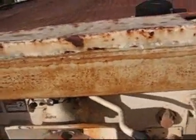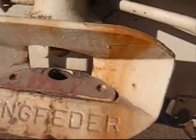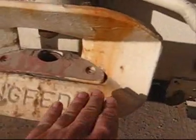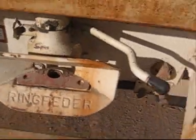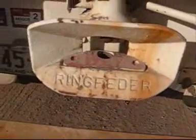Simple as that. All you've got to do is make sure that the drawbar is at the right height or a little bit low, and that's why they have this beveled edge as well. It doesn't matter if you're not directly straight on, it'll hit there and slide across and lock in, or if it's too low, it'll slide up and lock in. And it's very easy to do on your own. You don't need anyone there to help you hook it up.